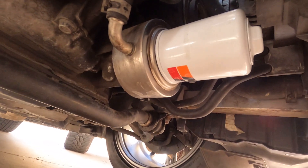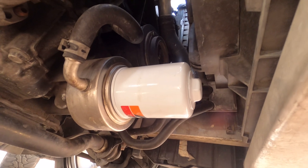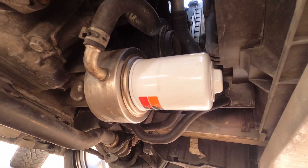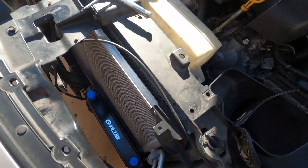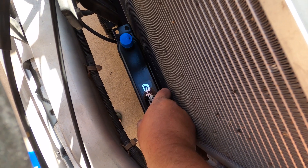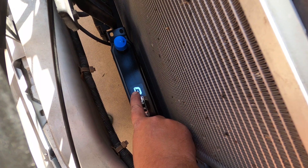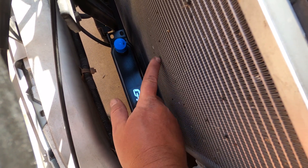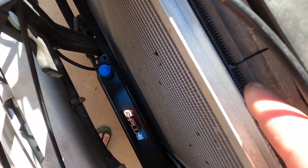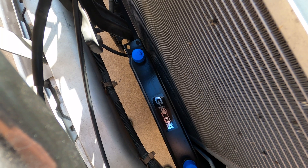Looking at the oil filter, I think there's going to be plenty of room to add the sandwich plate — it'll go right between the filter and the stock oil cooler, which is also an oil heater. For our application, we want to make sure we leave about a finger's width gap both at the top and bottom of the heat exchangers so that radiant and convection heat can do their job. You can see the oil cooler is stepped out just a little from the AC condenser, and the radiator is behind that with an air gap — we just want to match what the factory has already engineered.